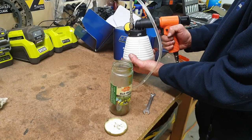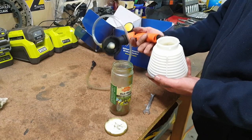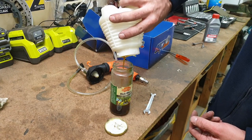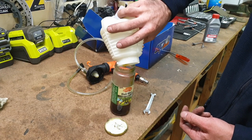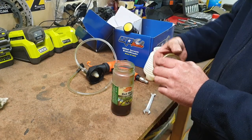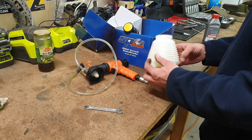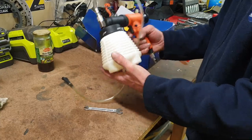And then when you're finished, this is like a paint tin, so you've got to rinse this out. You get your old fluid and you put it in your favourite jar — keep it somewhere safe because it's horrible. Yeah, so I just thought I'd show you that because it makes bleeding brakes and clutches, and anything on any vehicle, a hell of a lot more easy. It is a vacuum brake bleeder — worth investing in. See ya.